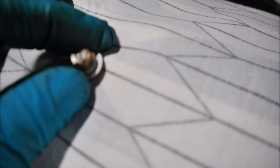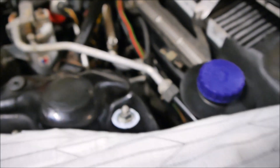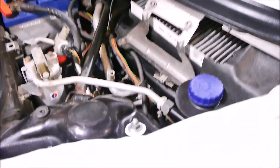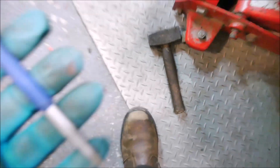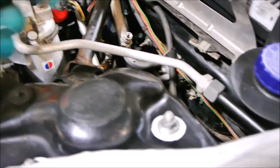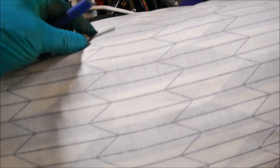My plan worked - it's out! I'm going to zoom in - this is the offending item and you can see where it's splined where it fits in. What I did was use a brass drift - but it was too long and I was nearly hitting the bonnet - so I ended up with a very short punch and a big lump hammer. As soon as I started hitting it I could feel it wasn't bouncing anymore. The reason is I've blocked it up underneath, so all the energy goes into pushing this stud out rather than bouncing around.